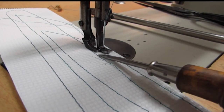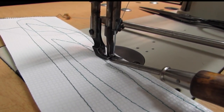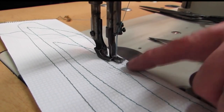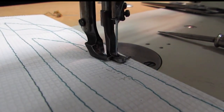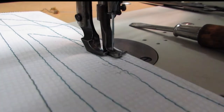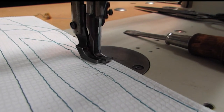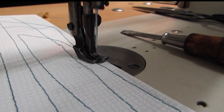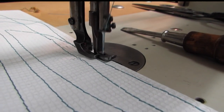It's gone too far, so I'm just going to lift the inside foot up just slightly as I'm turning the hand wheel — not too much. Loosen that same screw — that should let the outside foot drop, which it did. That makes the inside foot lift a little bit higher. So that screw works for both; it just turns them around so you can get them lifting evenly while sewing.